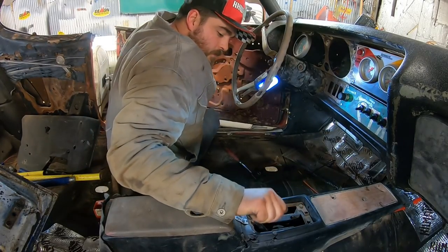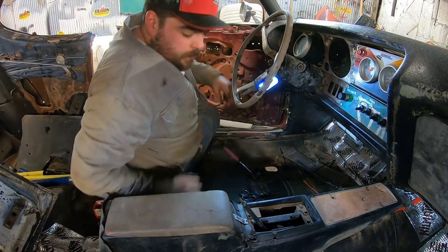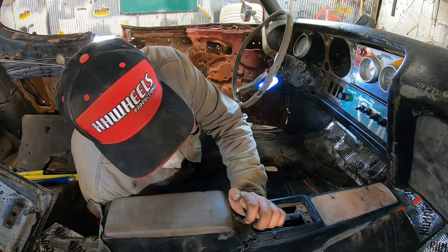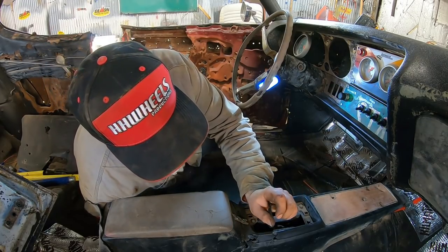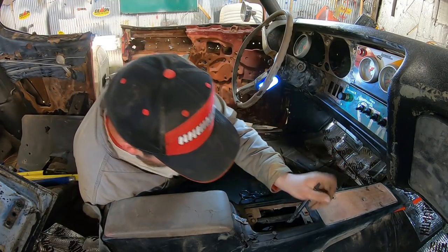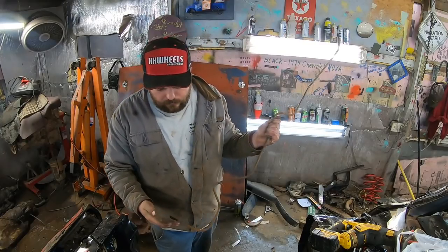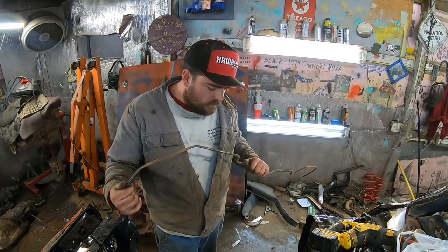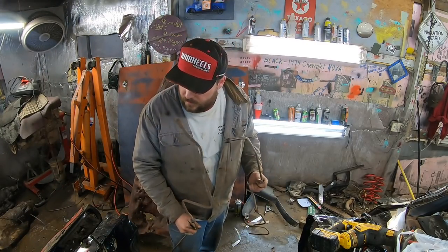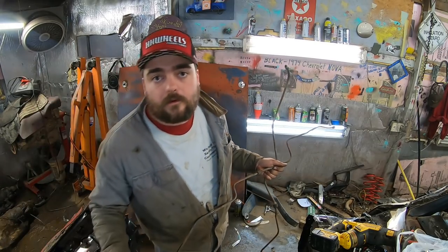Things are happening down there. There's your ratcheting action for that shifter I was talking about — only some GM shifters have it. I cleaned it up pretty good. If you push the shifter over: lock, back, over, second, lock, over, third — theoretically. Could be neutral. Neutral, reverse, park. That feels pretty good — I think that'll work for us. We need some transmission lines. We could use the original ones — they actually don't have any bullet holes in them. We'll cut the ends off them and run some rubber hose up to her. Might as well clean them up since they are in remarkably good shape.